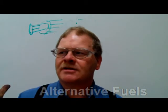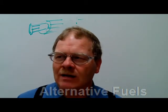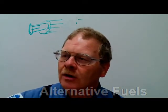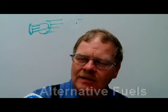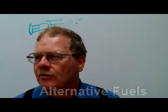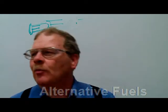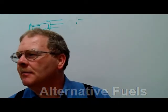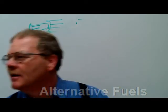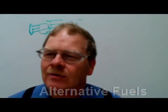Now, Dr. Meadows came in here in his pickup one day, back whenever he was president of the college. He had a 91 Dodge Ram. And he says, when I turn a corner, it cuts out on me. But as long as I'm driving straight, I don't usually have any trouble. And so I got a fuel sample, and it had water in it. So I poured about a quart of alcohol in there. Alcohol picks that water up and lets it go on through. And that took care of his trouble. We didn't have to drain the tank and all that. I mean, it was a quick fix, you know.